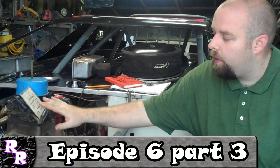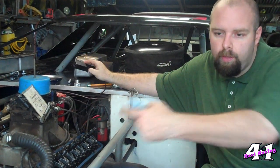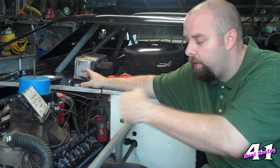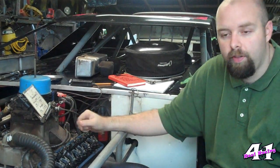I've gone through and set everything that the card tells me to set at top dead center. What we need to do is take my bump start button and turn the motor over 360 degrees. I'm going to bring it back so that my pointer lines up at zero. And when I do, neither one of these should be loose — and I know I'm 360 off and it's time to set the other ones.